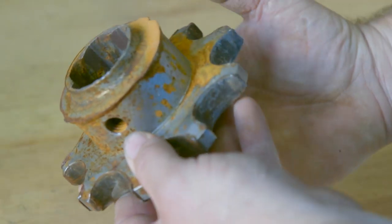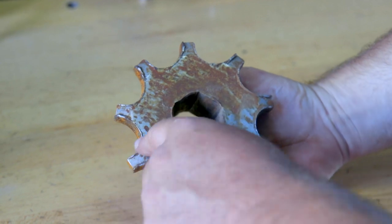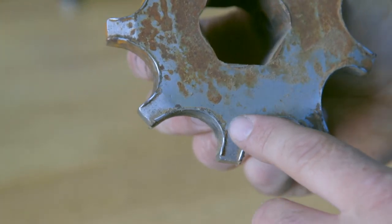You don't see a lot of wear on slats — most wear in the feeder house chain is going to be the chain itself. A good indication that your chain is worn: look at your top sprockets. They'll usually start getting cupped, or you'll see side wear on the sprocket itself. The cupping is pretty obvious — it'll make like a C-shaped pattern. One very important step: don't ever put a new chain on a cupped sprocket, or you'll wear that chain out extremely fast. So if you're replacing one, you need to replace both.